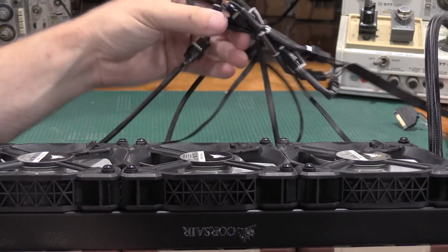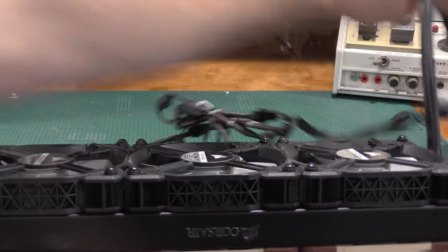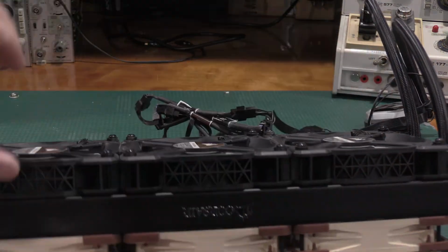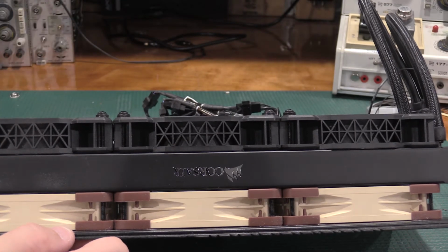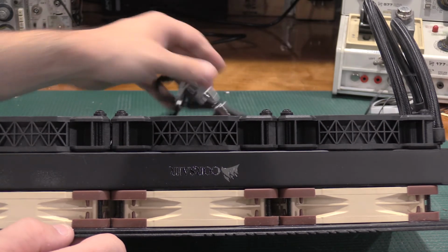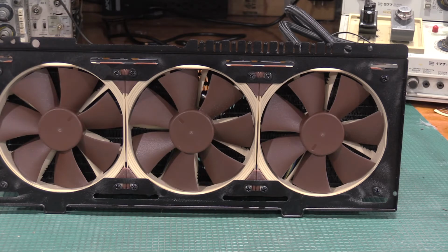The way I wired it is all the Noctuas actually come with a Y connector. So all the fans are actually powered by the pump. The way it's set up is it's 2 sets of fans. So with the Y port, the pump controls these two, and these two, because it's got 3 inputs on the pump. So everything worked well there. I am going to tie these up tighter, make them look a little bit better, but without custom length cables, there's only so much you can do. But let me tear that apart, and I'll be back.